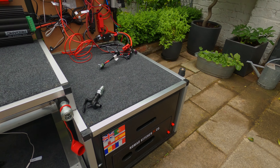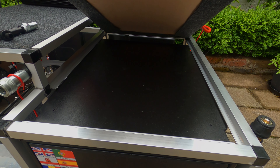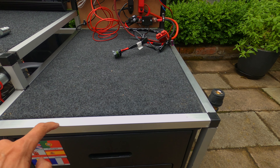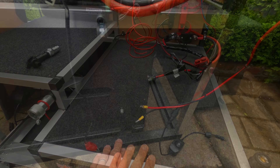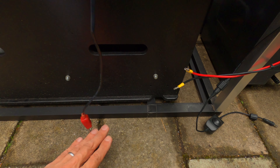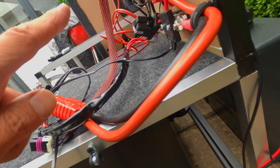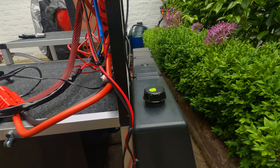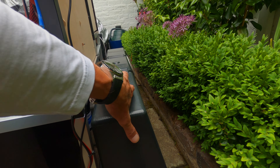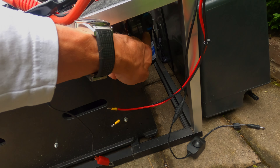This comes out pretty easily, and I've built it so I can pop this panel out to get underneath it. I'm going to put a couple of screws in here to hold this in place so it doesn't move. I've put an extra bracing point to allow this to sit flush, and just inside there you can see the water pump. That water pump will run to the line that comes out from the exit point. The tank will go flush up against the back of the seat and against this panel here, and I'll route the output from the tank through to the inside of the pump.